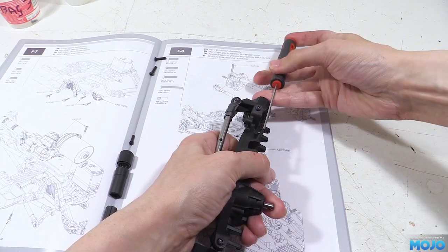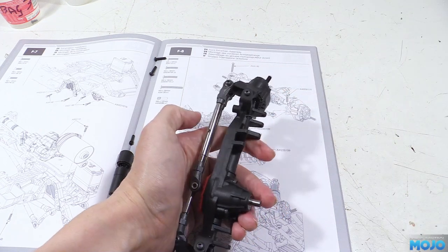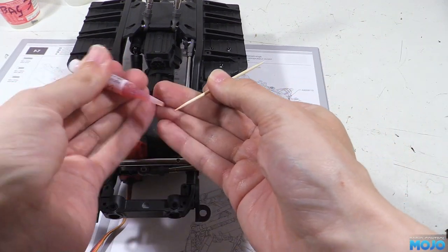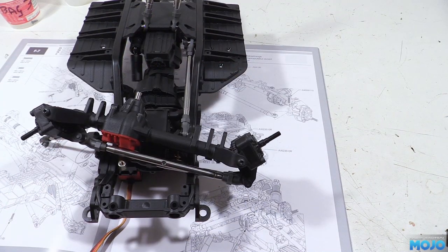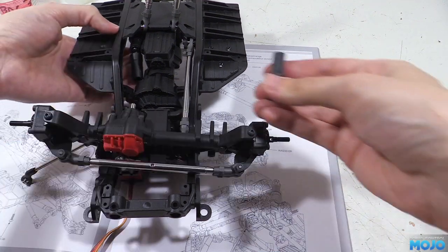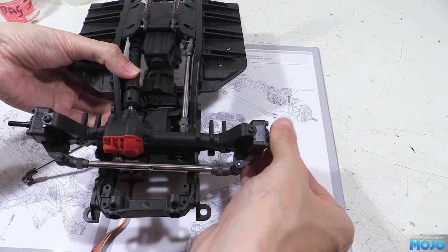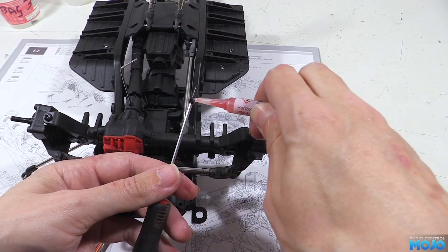For the next part we're going to fit the top link to the top of the axle. To make things easier we'll start threading the M3x14 into the plastic now so there's one less thing to keep hold of. Next we bring the chassis back, pop the upper link into the slot and do up the screw. The short rod needs to get attached to the servo arm's hole next — it's metal on metal so we'll pop some thread lock into the threaded hole before fitting the rod. Just a spot stirred around with a cocktail stick will do. Now offer up the rod end, pop in the M3x12 and nip it up. Lastly fit the drive shaft — the spline section fits into the gearbox and we slide the other section over the end. Make sure the two CVs are in line at the same angle, otherwise you might get vibration and in extreme cases shorten the life of the joints. The CV then slides over the shaft on the axle, line up the holes, apply a bit of thread lock to the screw pin and install it.